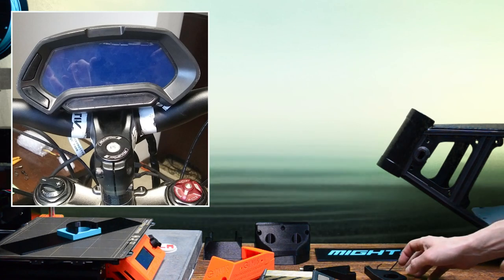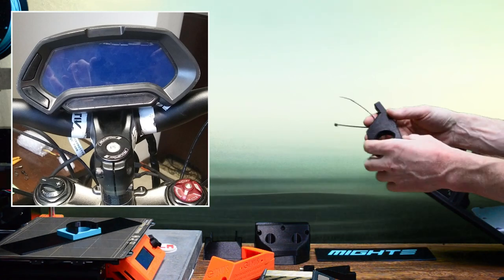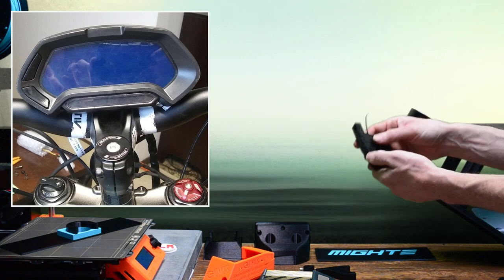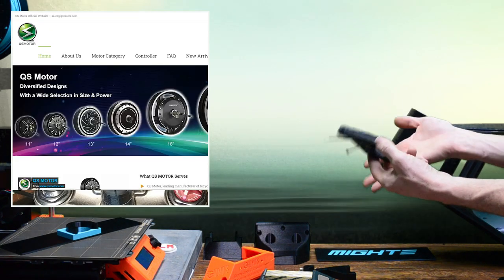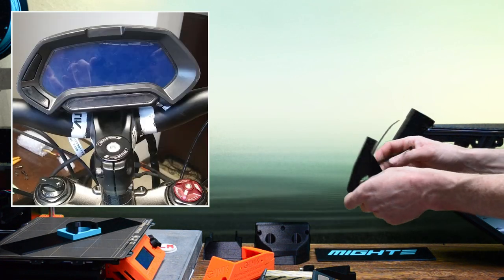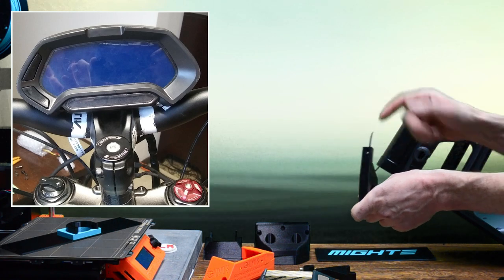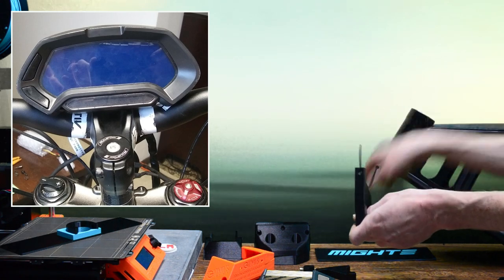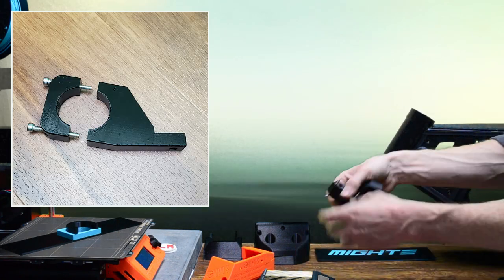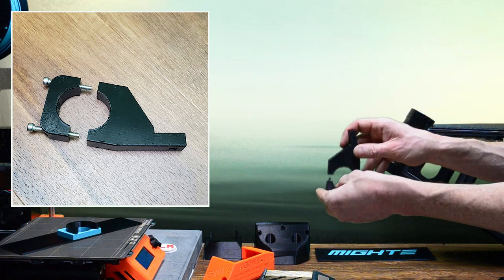As well as the 855 work, I've also made these custom handlebar brackets for mounting the display that's used a lot with QS motors but apparently doesn't come with them. These are going to go one each side of the stem on the handlebars and then the display bolts in through these — just two parts with the nuts embedded in this piece, and it just bolts onto the handlebar.